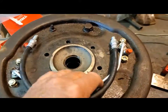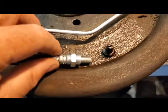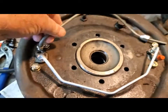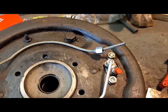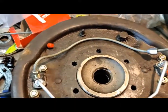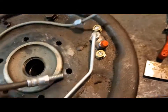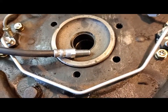The next problem is that the brake hose from the 88 has a fitting on the end that's made to go straight into the wheel cylinder, and I'm not going to be doing that. I'm going to be coming from my cheater pipe up to an acorn nut that I got from an outfit called fedhill.com — F-E-D-H-I-L-L dot com. But it won't attach to this end of the brake hose properly; it needs to be a flare-type fitting like on the other end of the brake hose.